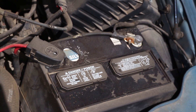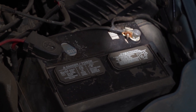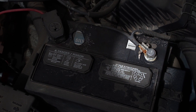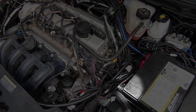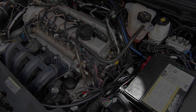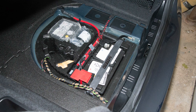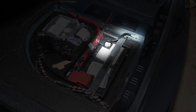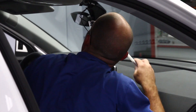Another location for a proper ground point can be the battery negative terminal. Although it's always an option, it is sometimes dubbed as non-desirable because it is usually located under a vehicle's hood. A battery negative terminal means that the vehicle's steel frame or chassis is directly connected to the negative side of the battery by a negative battery cable. Though it's usually located under the hood, different car manufacturers may have the battery terminal in a completely different location, such as under the trunk. This means that if you were to use the negative battery terminal to ground your dash cam, you'd have to run all the dash cam and electrical components from the battery location into the interior of your car where your dash cam will be mounted, which is very inconvenient.